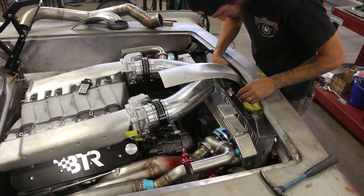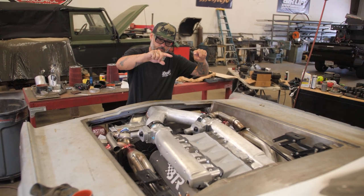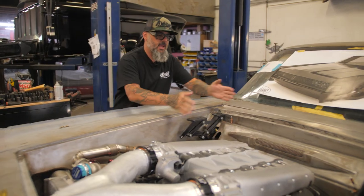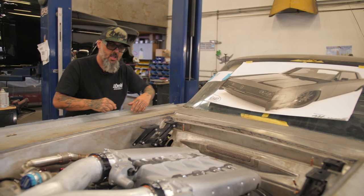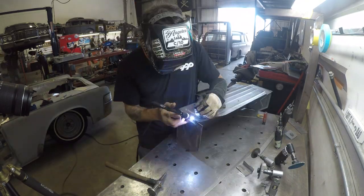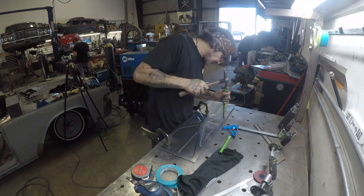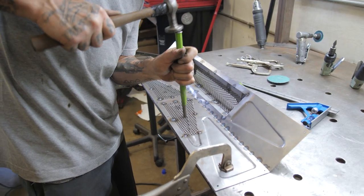Now what we're working on is all the sheet metal around the engine compartment. Peter's knocking out the intake tube. Seven's going to jump on the firewall piece — we're going to sheet metal all that in. We've got billet hood hinges going in there, so we have more sheet metal to do around those to hide everything because we want it to look super clean and super fresh. When you put an LS motor in here, there's a ton of room between the stock firewall and the motor, so we're going to use up that space with a battery tray. It'll be the second battery in the car, just for accessories and the stereo. This one won't be used to start the car — it's an accessory battery. When we turn the key on, it'll turn this one on and charge off the system. It'll also have a battery tender, so if the car sits in the garage for a month, you just plug it in and it charges both batteries.